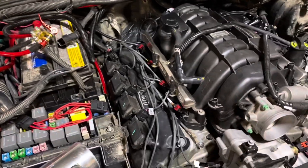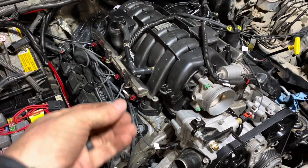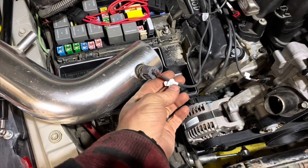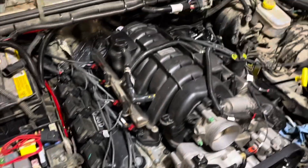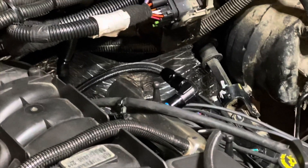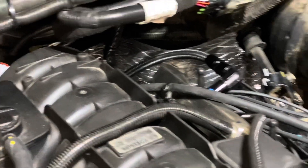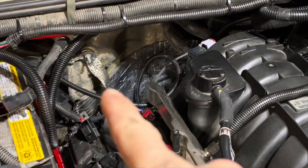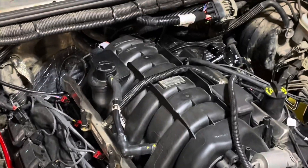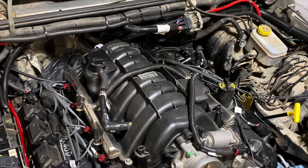Battery's in. I've got all my wires in the right place — I still got to wrap them up, tighten them up with loom. I've got my air temp sensor mocked up here inside my cold air intake. Got the fuel line on that we made right there. That's all connected. You just push it on, it clicks, and then you just run that around the back, down through there, and then hook that up to your gas line. That's also just a click in. Just keep it up out of the way so it's not touching any exhaust or anything.